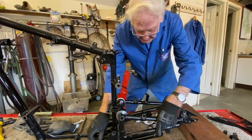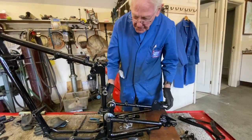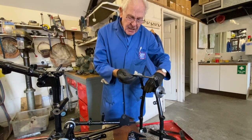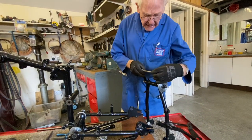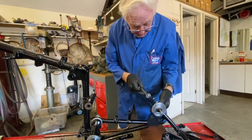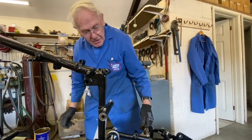So you're pretty well shaped up to slip the swinging arm in situ — that comes through there, that should sit on there nicely. Feed this through here — that works nicely like that. This is the top member — you remember we marked these, so you put that with your bit of tape on there as the swinging arm spindle, so you know you've got the right one in. These are new shims here — somebody had put in before but they were pretty rubbish old things, so we've gone to our stores and got some nice shims. Pop that in there, a bit of grease in the spindle, a bit of grease in there — we'll give them a shot of grease later.